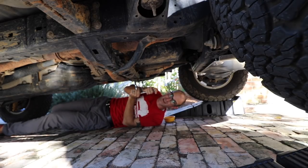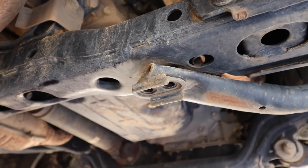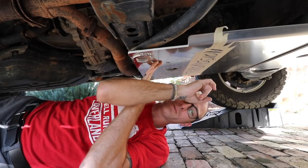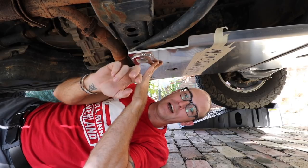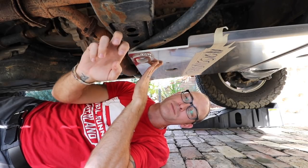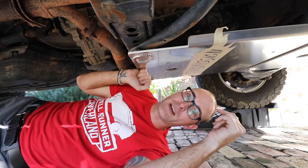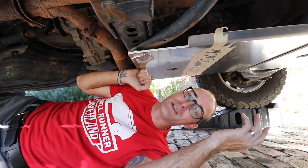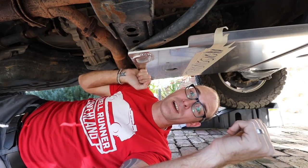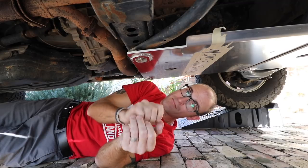You can see where I really banged up these cross members. Now, that nylon bushing that was up front — they actually want it in between the skid plate and the cross member. You have to lift the plate up a little bit to slide the bushing in between it and the cross member, so that aluminum-to-aluminum contact is avoided. Pro tip: make sure you leave that bolt unthreaded by about a quarter inch — I'd go as much as you possibly can. And if you're due for a fingernail clipping, put it off, because longer fingernails help slide the bushing up. Keep everything loose until all pieces are installed, then tighten everything at the end.